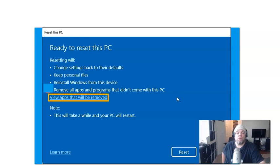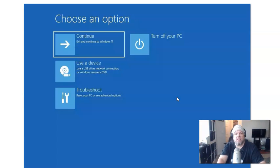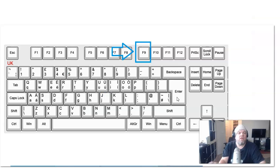And what I want you to do here is I want you to press F9 like crazy. Just tap it. And then turn on the Razer Blade after it's completely shut off like this. Tap, tap, tap. And that's going to prompt the BIOS to start the recovery process. And that's where you're going to be able to basically do a full factory restore directly from that. And again, I want to show you what the key on the keyboard F9 looks like. F9. So just tap F9 like crazy.